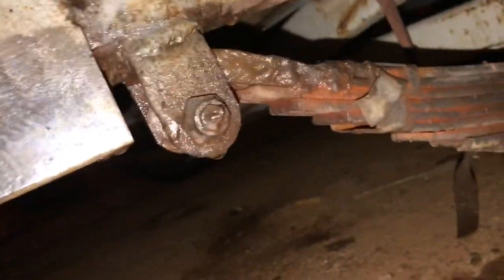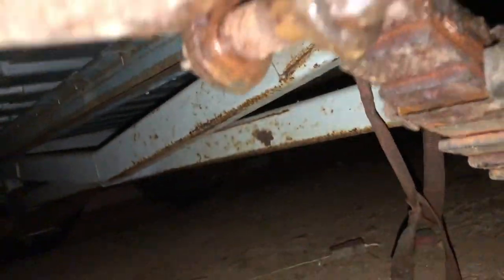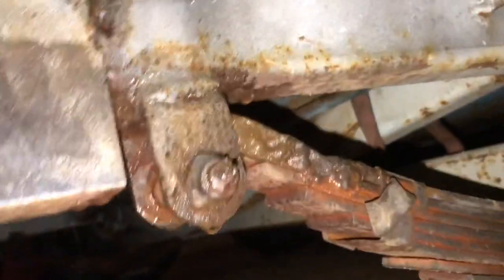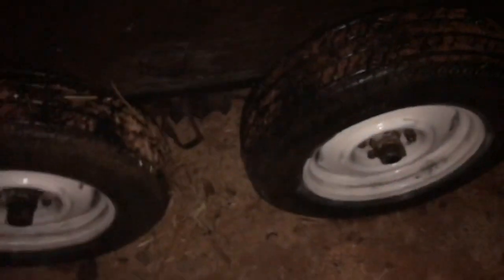Here's my trailer — tandem axle — this has been sitting for nine months now. You can't really tell, but that leaf spring is broken. It should be sitting there but it's not. It's broken so it's sitting up on the frame, so the deck of the trailer is a little bit lower right here. Basically what I'm doing is when I hit a bump that leaf spring is going to want to drop, so I'm making a bracket right now to kind of hold it there. I've got one more axle in case this doesn't work, but I'm going to put an 8,000 pound truck on this trailer and tow it back, which is a two hour drive.